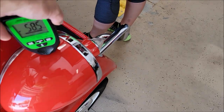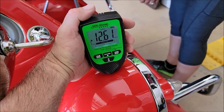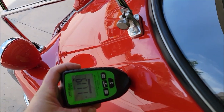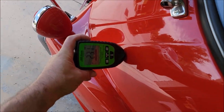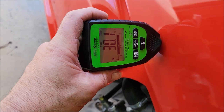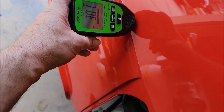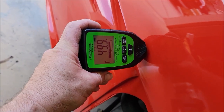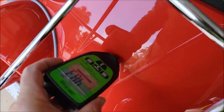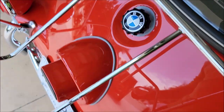It's weird — it won't read in some spots. Let's see where we're at there. 11. So we've got lots of material and I'm pretty sure all that material is Bondo. 12, 11 — yeah, I'm pretty sure we're reading a bunch of Bondo. 22, 23, 30. Now let's go right over where the issue is — yeah, it doesn't want to read there. I'm guessing it's because there's so much Bondo. 49.9, and then it doesn't want to read — all that Bondo, it can't read underneath it. 48. These things are only good for telling you total thickness: 32, 34, 32, 43.